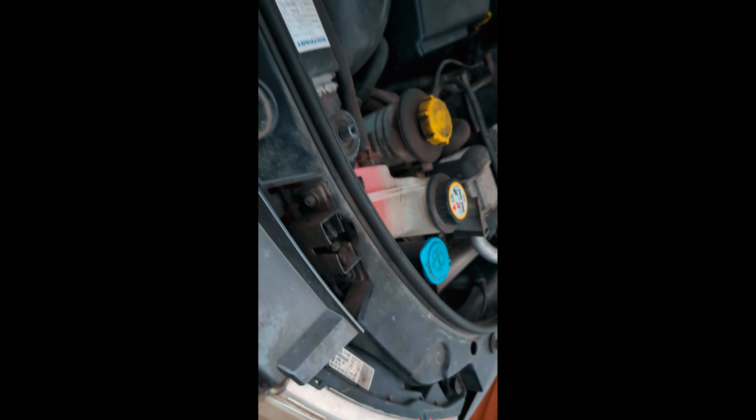Hello, welcome back to another episode. This is a quick little episode on my Discovery 3 Land Rover. The alarm keeps going off and every time I'm driving there's a warning coming up even though it's shut. What it is, is the latch and switch — it's got a little alarm sensor thing on the back of the latch, which is here. It sets the alarm off if somebody tries to open the bonnet, so mine is obviously faulty.